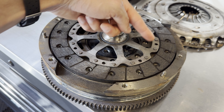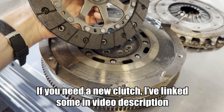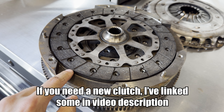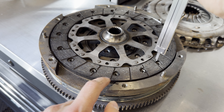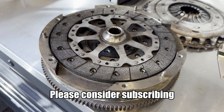So work your way around the clutch. If you want to do both sides, this comes off the flywheel — you can do both sides if you want to. But don't let anyone tell you that just because this is flat and the grooves are gone that your clutch is worn out. You've got to go from the rivet flanges, not the smooth portion, but from the little flared portion right there. And that's how you measure your clutch.